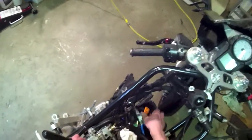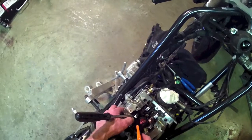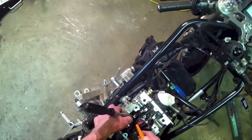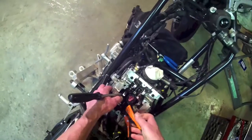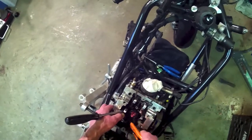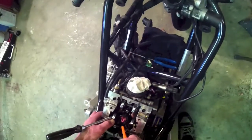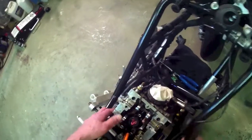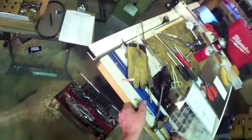I'm just working this — it's a bit Mickey Mouse — but these jaws are very carefully machined to mate against the valve stem, and it's just being a little bit awkward here. I'll push that down; it feels just a little slack, so I'm going to tighten it up and start over. Now it's firmly clamped onto the valve stem with clearance between the tool and the keeper shim.